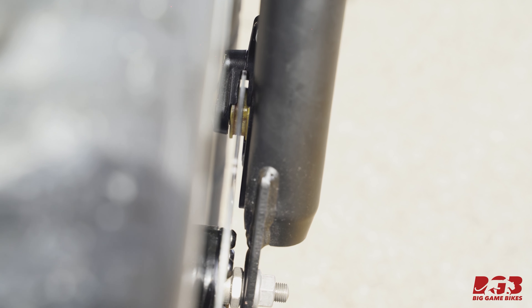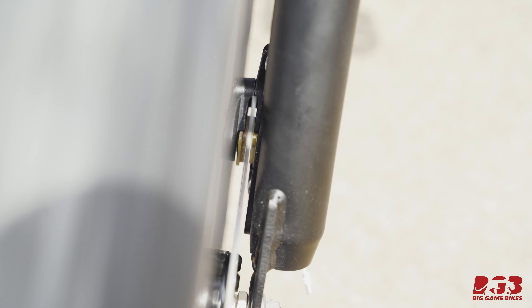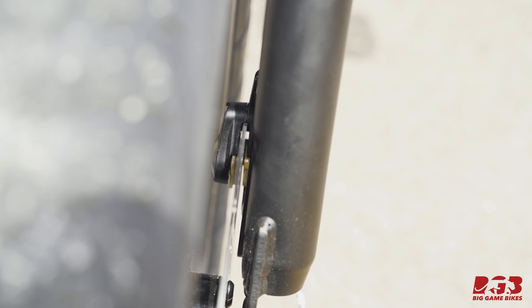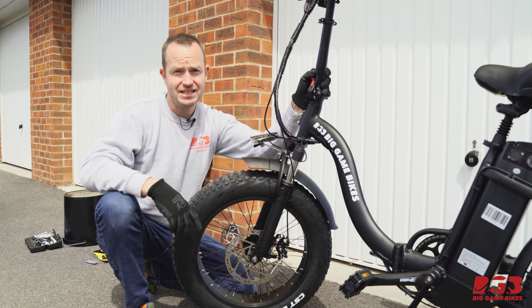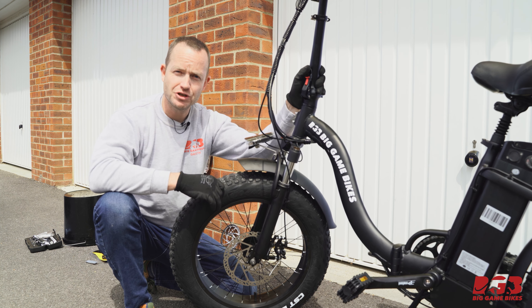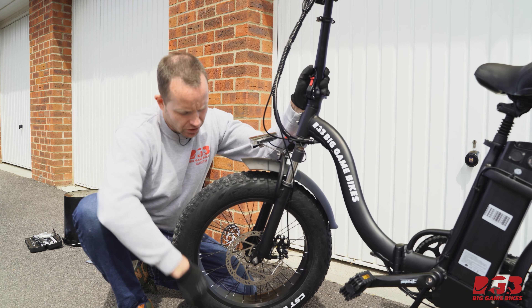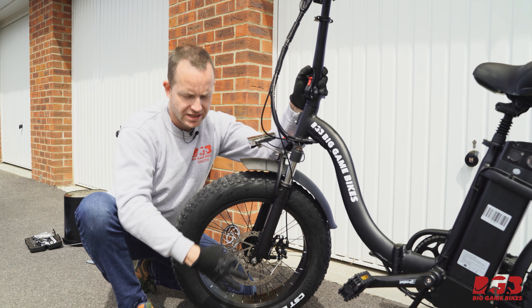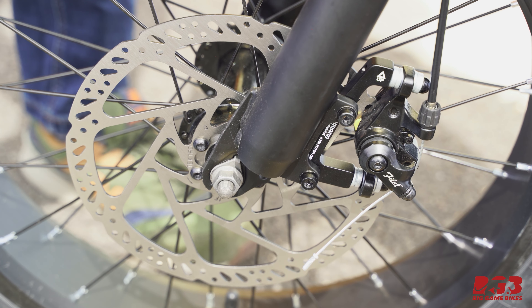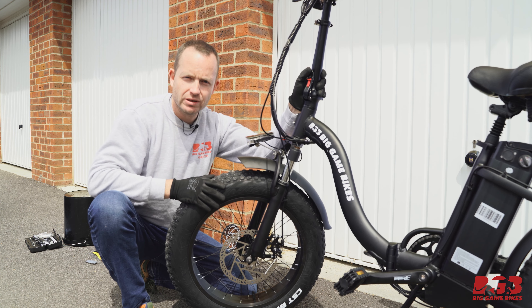As you can see, the brake pads are nicely aligned with the brake rotor. When we lift the wheel and give it a spin — caliper is on, new brake adapter, lovely big rotor. Follow exactly the same process for the rear wheel. Right now the brake rotor is a beautiful silver color; when I come back from my test ride we're going to see a nice gray strip where the brake pads have made contact, and if our alignment is perfect that strip will be consistent all the way around the rotor.